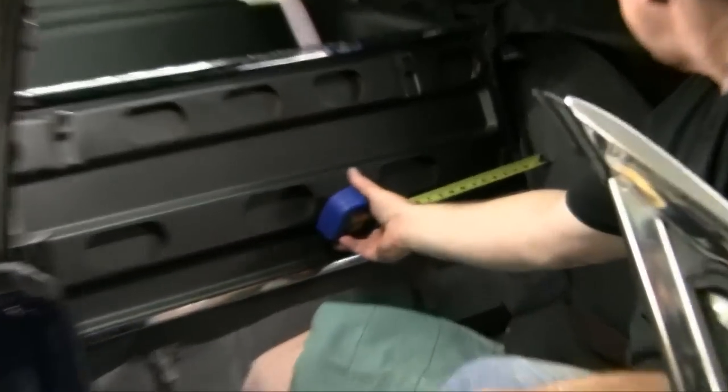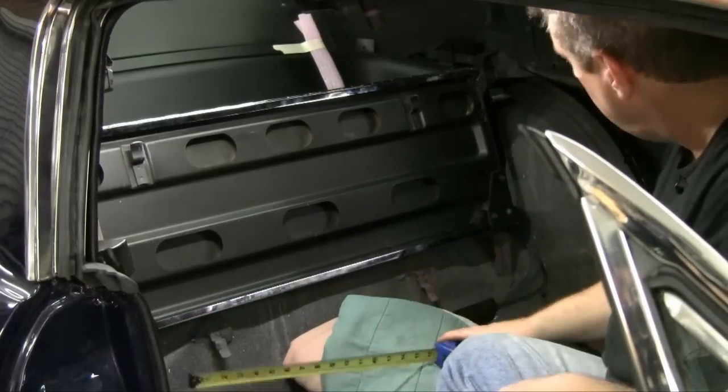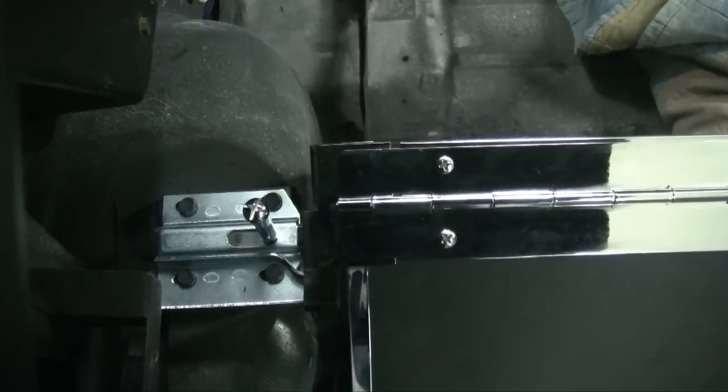You also need to check your distance between the wheel wells for the seat. On this car we're at one and a half inches on both wheel wells — I'm not going to argue with that, that's perfect. There's enough room in those bolts that if you needed to go side to side a little bit, you could. Another thing you may have to do with these pieces is install a shim — there may be a case where your latches are not mating up correctly. This was a problem with these cars even back when Ford was putting this together. They'd shim this little section with a dual shim setup. You can go down to the hardware store, grab washers of the right diameter, and do the same thing.